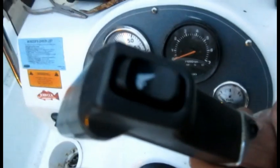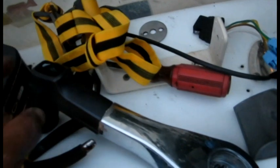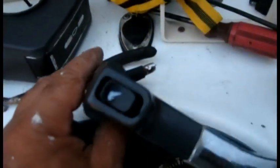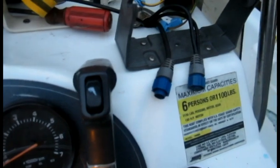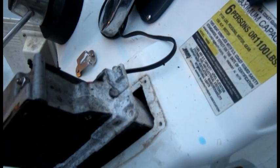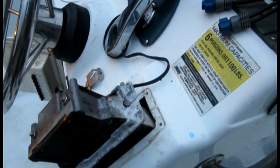If you are able to clean the switch right here, you don't need to do any of this. I should have been able to get to that switch, open it up probably in 15 minutes. You've got to disconnect your battery because this is a hot wire. If you have to replace the switch, it's a $100 switch for Suzuki. I hope this helps you out. Overall, if changing a battery is a 3, this is about a 5 — on a scale of one to ten. Good luck, bye.